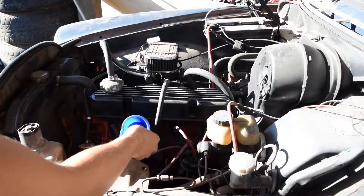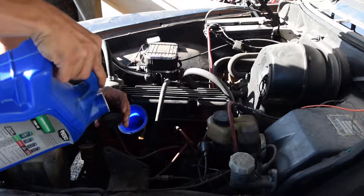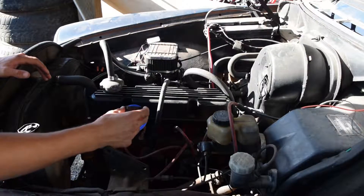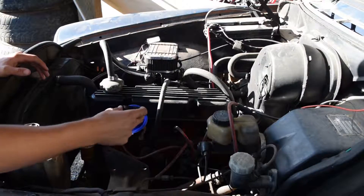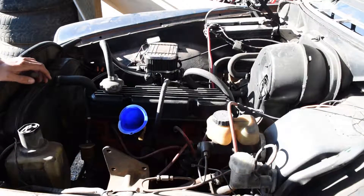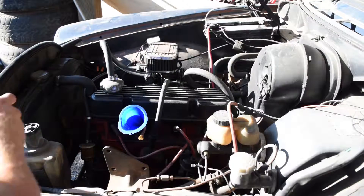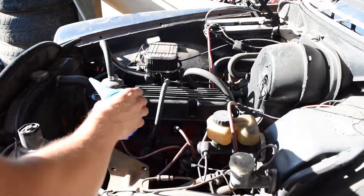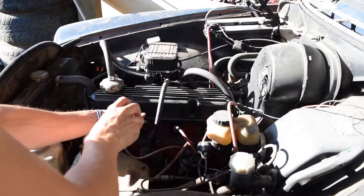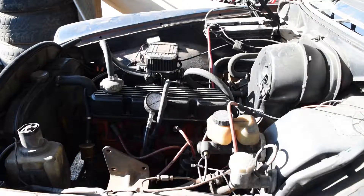So we're going to put some oil in there. I've got a funnel. You really don't need that much oil — it'll work its way in. I'm going to be using 10W-40 — I'll put it in the cap. Not a whole lot. The car has 10W-40 oil in it, so I figure I'll just put the same oil. You just put the oil in there, and then do the compression test normally how you normally would. And if it raises the compression, then that's a good sign that your rings are bad and the engine's got to come apart for that. Let's see what it does now with oil in the cylinder.